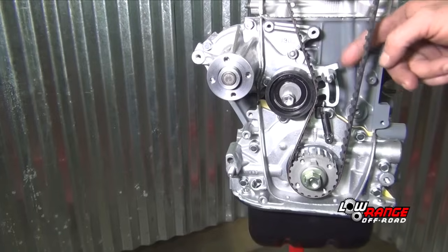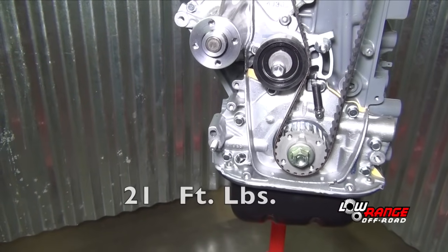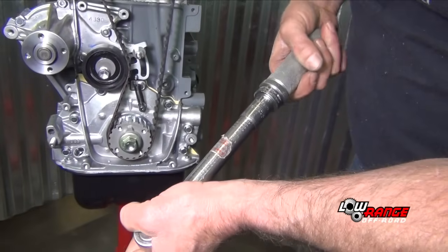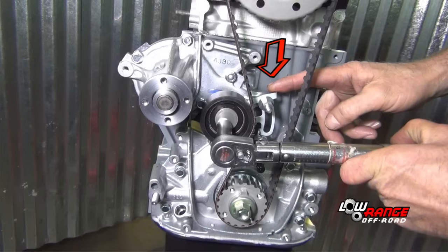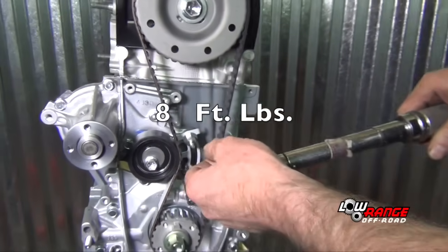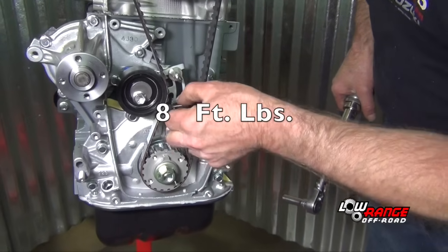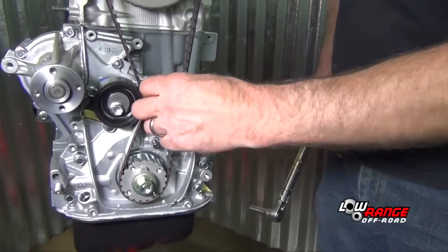The tension spring should be holding tension on it. I always let it kind of ride and then hold a little more pressure on there. We're going to torque this one at 21 foot-pounds and this tensioner bolt at 8 foot-pounds. Set our torque wrench at 21 foot-pounds with a 12 millimeter socket. Notice that the technician is applying a little extra force to the tensioner before tightening the tensioner bolt. Reset our torque wrench at 8 foot-pounds. I always take the spring off because it's doing nothing at this point — it has been known to fall out and fall into the timing, so I just take those out. Once I use it to tension it, it has no purpose after that.